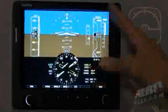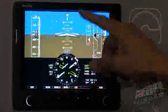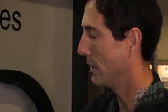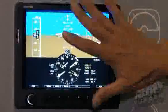It's a large display — again, 8.4 inches diagonal. It's really designed to replace the six-pack instruments in the aircraft today. So if you have all your round-dial six-packs, it's designed to take those out, and you reinstall a piece of instrument panel that hosts this unit and it fits right in the holes where the six-pack goes. We're anticipating a very easy installation for the dealers — install and fly away, with a good lower cost on the installation as well.